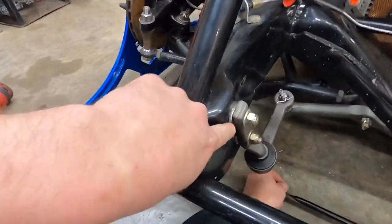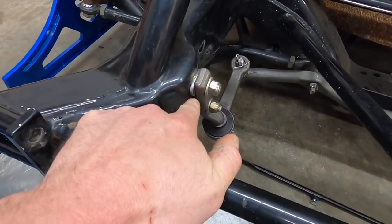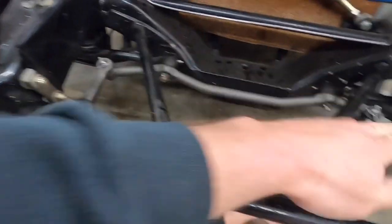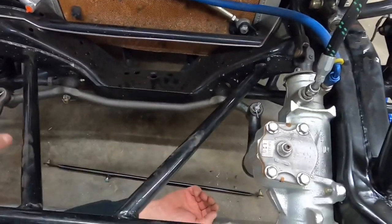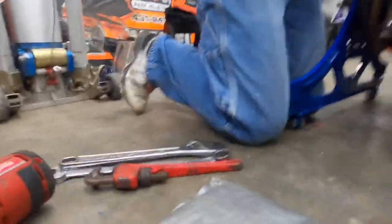This had spacers in it right here, so we're going to have to take this off and get these — I call it three-sixteenths or so worth of spacers — and shove this back in, because between here and here is too short. We need to get the same measurement on both sides, so let me peel that off and we'll come back and continue the toe setting.